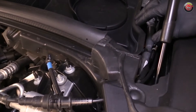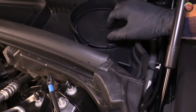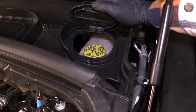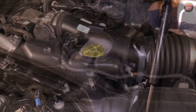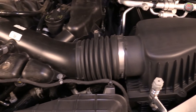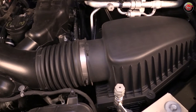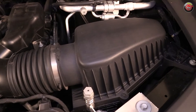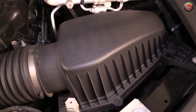The brake fluid reservoir can be found at the top driver's side near the base of the windshield under a plastic cover which can be easily accessed — it's just a little bit hidden. Replacing the air filter can be done at the front driver's side of the engine bay, though you will need some common tools to open it up, as they weren't kind enough to just give it a couple of pop clips like most air filter boxes.